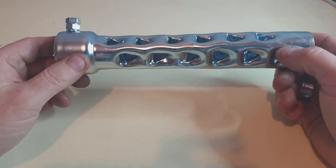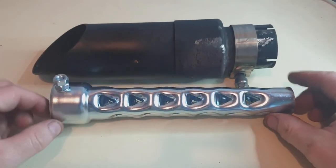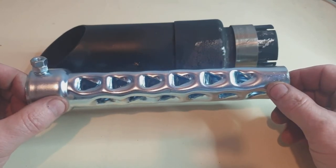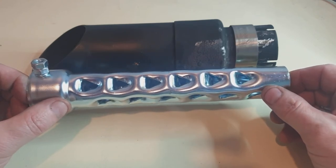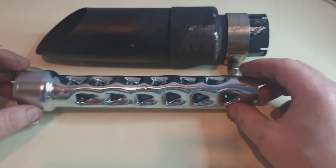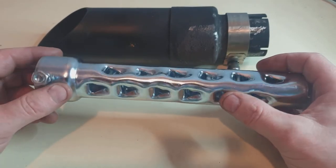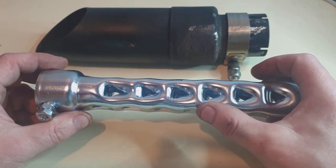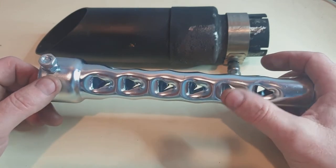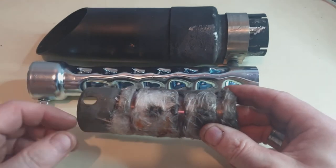So what I ended up doing was going online and finding one of these universal baffles. I bought a kit which came with some gauze to wrap around, and metal cable ties as well. The universal baffle is quite long compared to the Radiant Shorty, so I ended up cutting it down. I'll warn you — this material is rock hard. Even with a metal hacksaw it took ages. If you've got a disc cutter or something similar, you'll be much better off. Don't try to do it by hand — you'll kill yourself.